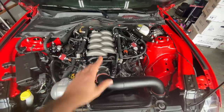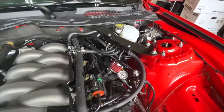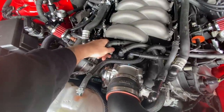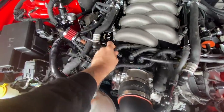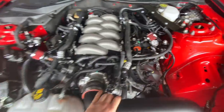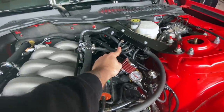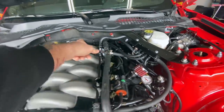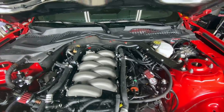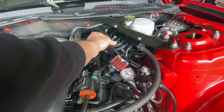Before we move on, I do want to simplify things a bit further. Being a twin turbo car, I have my vacuum block right there. The main source is coming off this PCV line because for the time being we have these in place of catch cans — Hellhorse Performance is supposed to be sending me a catch can. This line goes down to my blow-off valve. We have bottom wastegate, top wastegates that are fed into the MAC solenoid for the boost controller. This is the boost controller reference line, and this one goes into the regulator.